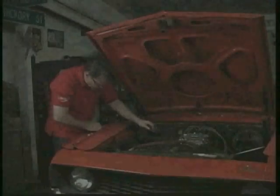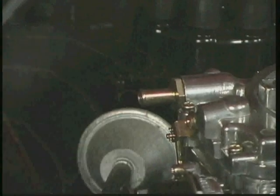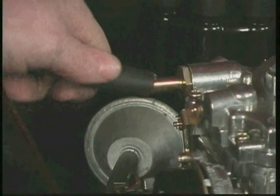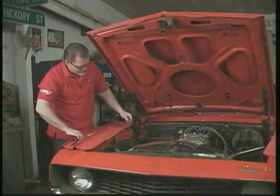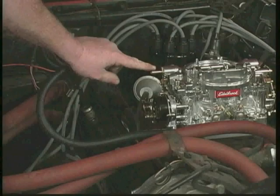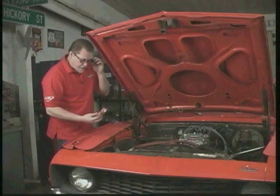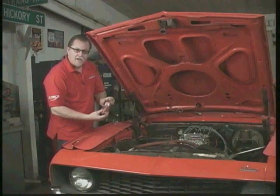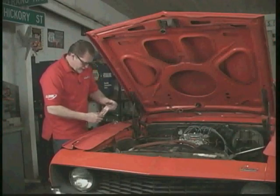Now that's ready to go. Edelbrock carburetors come with a fuel fitting that comes straight out the side — this is standard equipment. We can take the fuel line and stick it on here, but just because we give you two or three feet of fuel line doesn't mean you need to use all of it, so let's cut it to size. Rather than use this fitting, we offer what we call a banjo fitting — a 90-degree banjo fitting, number 8089 — which lets us reroute the fuel line to a better angle.